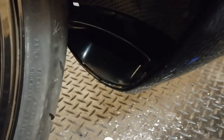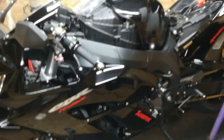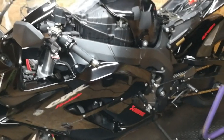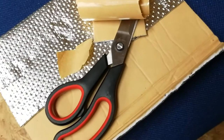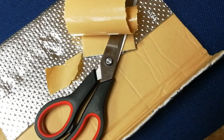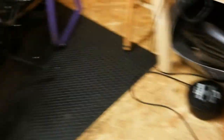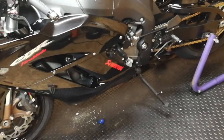It's not that you'll lose clips, it's just that I'm being a little bit fussy — I just like to put some new clips in there. The other thing I did was to fit a little bit more heat-proof heat shield sticky-back stuff, and I did that because of the titanium exhaust. I've actually wrapped the exhaust on the bottom as well, just to protect my plastics a little bit — it does get quite hot down there.